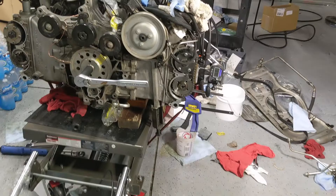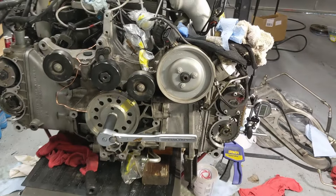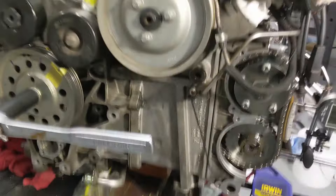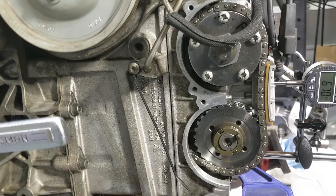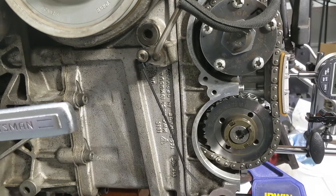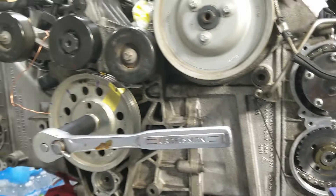I'm going to try to explain how to set your timing on a 997 turbo. Essentially I've got a dial indicator set in the cylinder, not making contact. I zeroed it out. As soon as it hits the degree wheel, you log that location. On the back side I've got a degree wheel. I've got some other marks here just to know when I'm coming up on those marks, so I can slow down on the downward stroke.